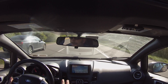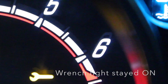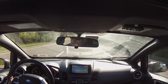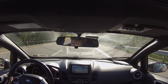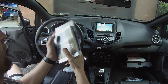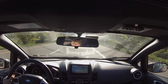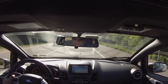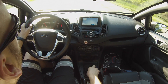Another issue was this strange wrench light that appeared on my dash one day — almost about a year into it, around 8,500 miles. I couldn't find anything about it in the supplement manual or the actual manual for all Fiestas. Thankfully, I found out that it is an oil reset light, figured out how to reset it, reset it successfully, and made a small video about it.